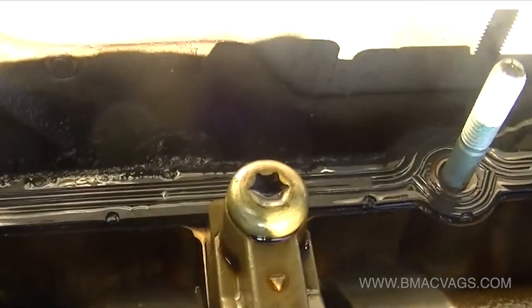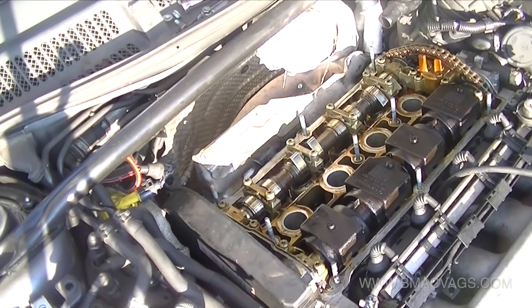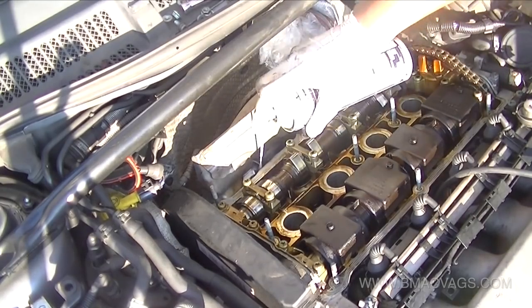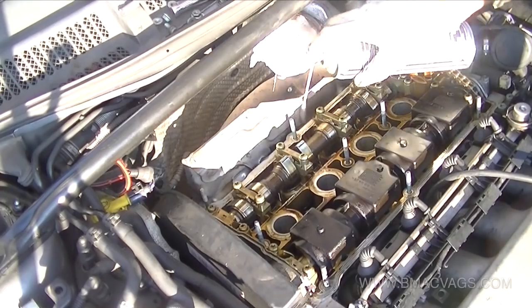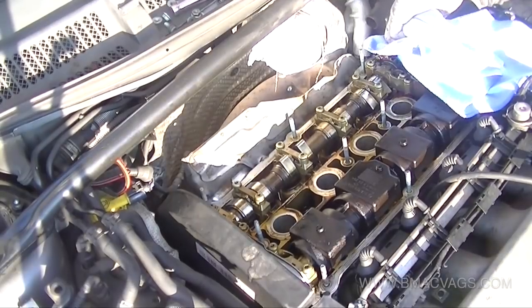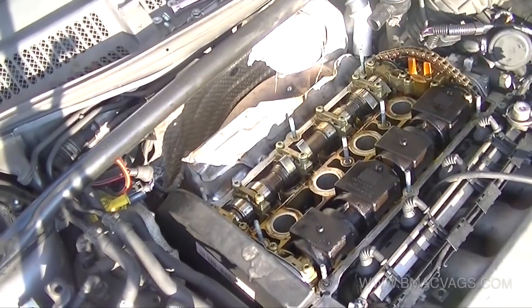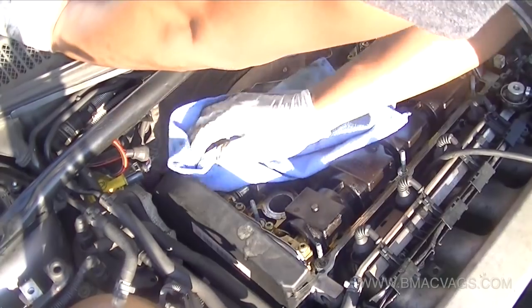It's a little bit fiddly but you'll get there. Now you can see at the back where the gasket was failing - it's all wet back there and that's what was burning on the turbo and giving a smoke smell. This is quite common on these cars and on BMWs as well. Pull that off and replace it. I sprayed with some carb cleaner to clear any residue.